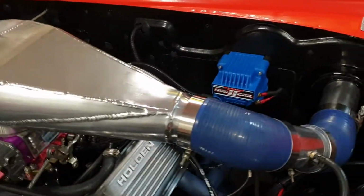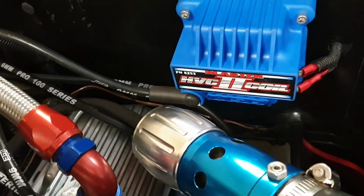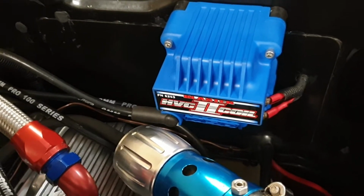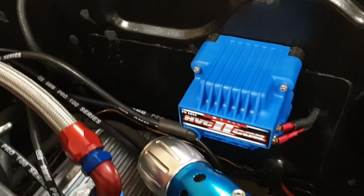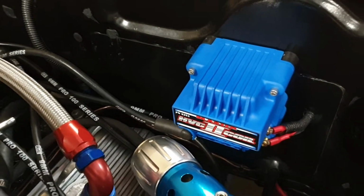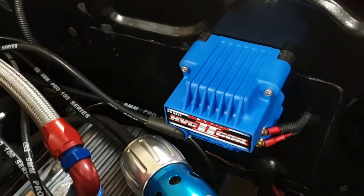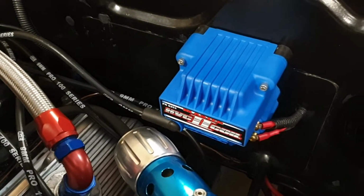Well, like I said, I've got my coil in, guys. That's the HVC2. So that's the biggest and the baddest one that MSD make for the 6 series ignition box. I'm on a forum for the blow-through mob on Facebook, and a lot of guys run this and have great success with big boost. So let's hope that we can ignite the E85 up top, guys, because that's a lot of the trouble I was having. I had the little cheap SS, which I'll show you.